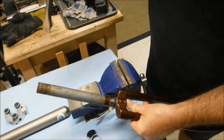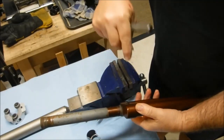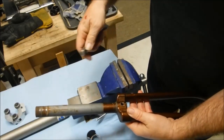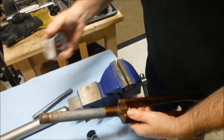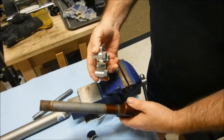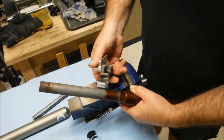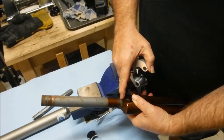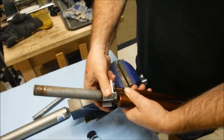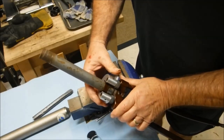There are a couple of ways to go about this. You could use a chisel or a center punch and go around and just put divots in it — as you drive the punch in, that increases the circumference by driving metal out. I'm going to use a knurling tool; this one is by Stein Tool. I've actually used it to adapt ISO crown races to JIS headsets — an ISO is 26.4 millimeter versus 27 for the JIS — and this knurling tool will actually increase that diameter enough to make it an interference fit.